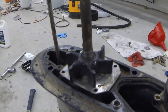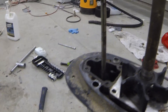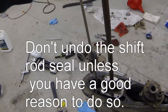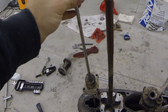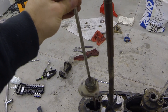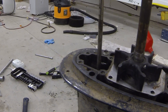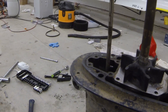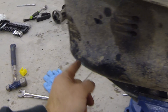One thing to note when replacing your impeller: don't undo the gear oil drain plug — there's no reason to, and it would let gear oil flow out of your lower unit. This is your shift rod, and it's calibrated by spinning it in or out, which adjusts the depth and selects your gear. When you remove the lower unit, if your motor is already shifting fine, tape the shift rod to prevent it from turning and messing up the calibration. If it's not going into forward or reverse properly, you can screw the rod in or out to push the dog more into reverse or forward as needed.